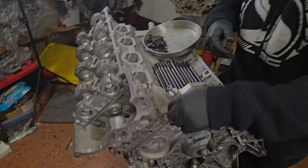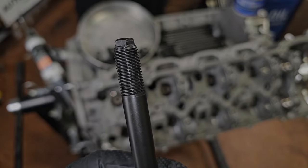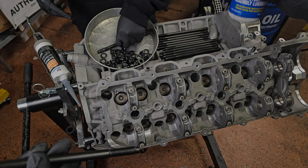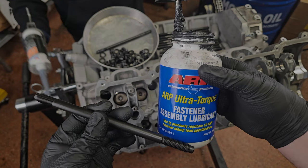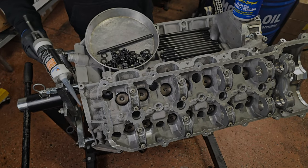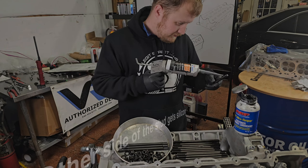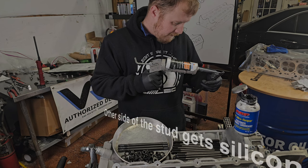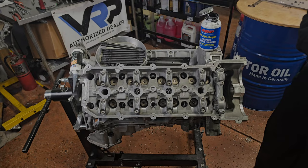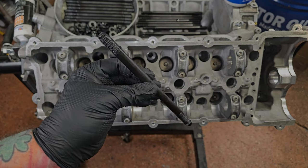Like a glove. Rusty's going to install the two front bolts for safety to keep the head on there while we go to work on the head studs. Rusty is going to put the right stuff silicone on the top threads of the head studs, and then the bottom - where we insert into the block - we will use ARP Ultra Torque fastener assembly lubricant. So: lubricant on the bottom, silicone on the top. Then we'll put them in, and then we will silicone the washers and the heads of the bolts. That's to keep coolant in the coolant passageways and not up through the head studs. It's 10 per side, so we'll do the first 10.